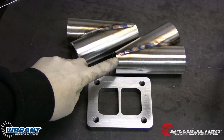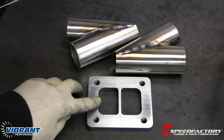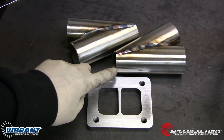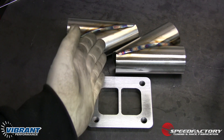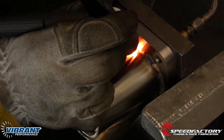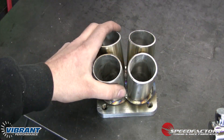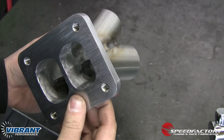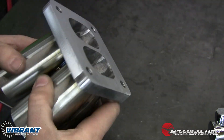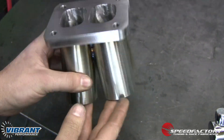To cut the mouth of these, I made them a little bit small because these need to be custom shaped to this turbine inlet flange. So I'm going to be cutting special angles on these in order to be swept out a little bit on each side to allow me to get into the middle and weld it. I did a little bit of minor porting and just made sure that the turbine inlet flange was machined flat, and this collector looks pretty good, so we're going to move on now to positioning the turbocharger in the engine bay.